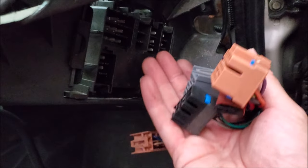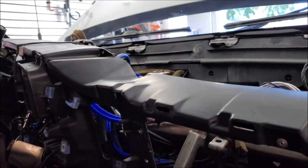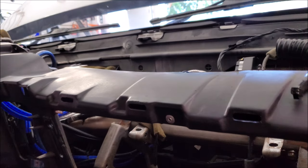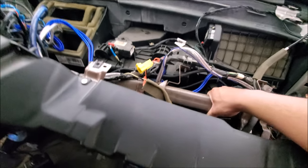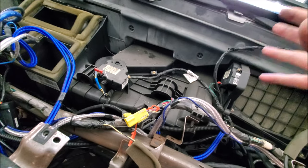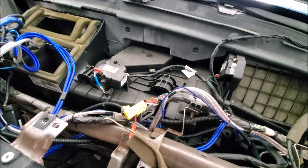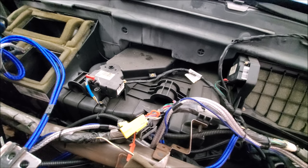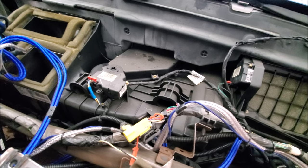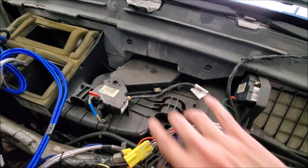You can go ahead and disconnect all the plugs off the passenger side. You don't have to worry about the plugs on the driver's side because we're just pivoting away, but you do have to remove all the fasteners so you can get those few inches out of it. After you have it all disconnected these subframes should feel pretty loose — now you have access. Now is a good time if you are having issues with the blend motors. You can check my other video where I show you how to do the reset. About 90% of cases they just need recalibration, but if you've done that and you're still having issues, now is the time to change them out.